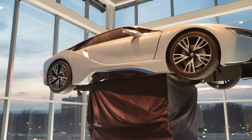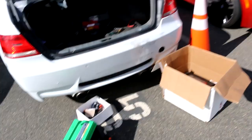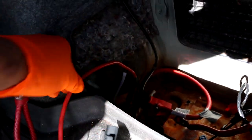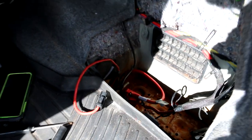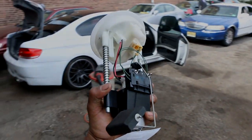I'm here at the dealership. Just took the battery out — you guys can see all the rust in here. I actually found the positive cable to be loose, the other one seemed loose as well. I'm gonna take this apart, clean it up, and may purchase a new cable from BMW if I have to. There it is all assembled and ready to go — let's get it back inside the car.